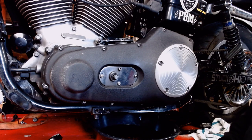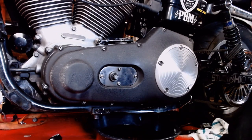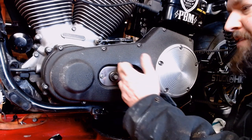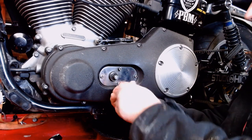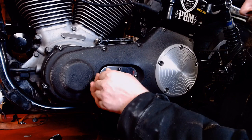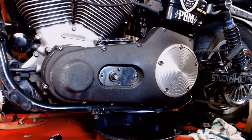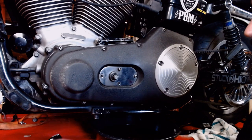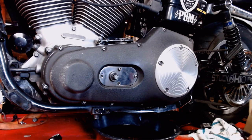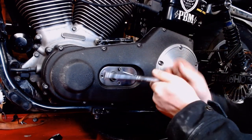But first things first. If you've got a stock bike, everything in here probably has Torx bits on it, which are these little star bits, like a T25 or T30. In full disclosure, I already broke these free. I personally really do not like Torx bits, so I swap them out with stainless steel Allen screws whenever I can. I didn't get to these two, so when we put this back together, I'm probably going to end up replacing these with Allen bolts. It's a quarter-20 thread, if you need to know that. There's two short little quarter-20 bolts, probably by half or three quarter inch, and that makes it a lot easier for removal and reassembly down the road. With Torx bits, the socket wrench doesn't always sit in there, at least in my experience, and they're easy to strip out. Then from there, pull these two loose.